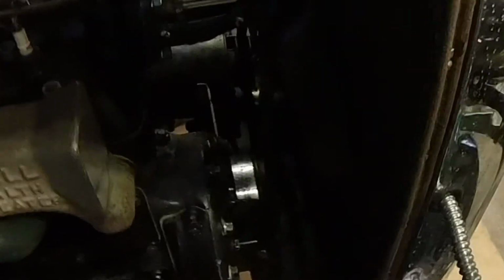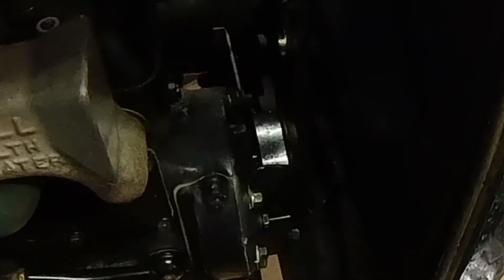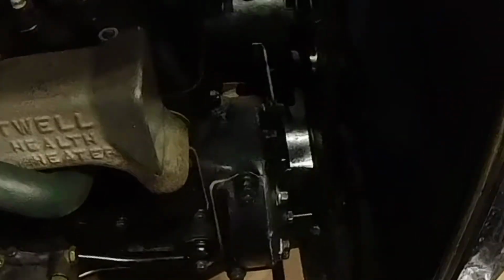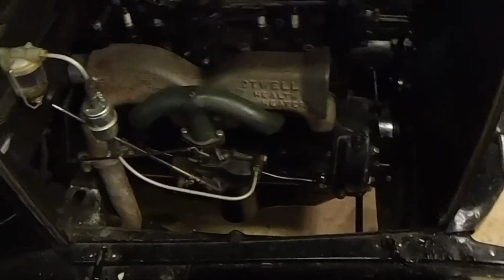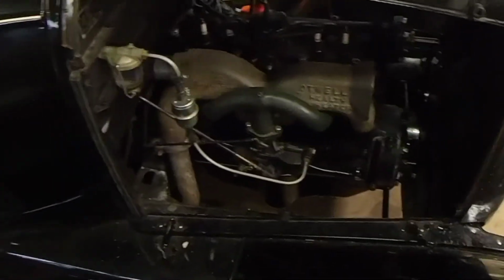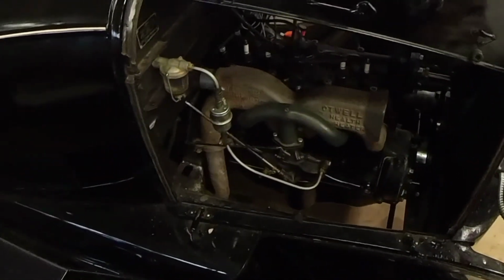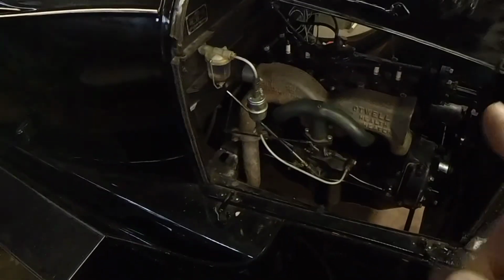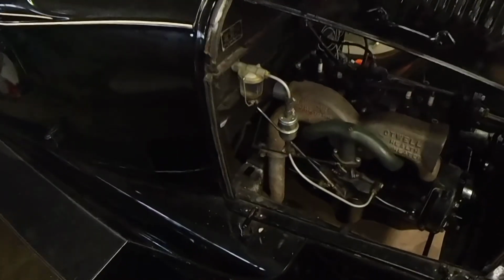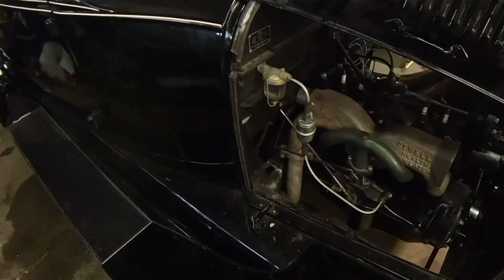And if you look down in the motor, you can see I built a little timing plate that goes in. Is that the shiny plate down on the pulley? That mounts there so I can get exact timing with a timing light. So I know now that when I use the special little cam wrench that they sell for these, and I put it where it should be, the engine is retarded by 10 degrees. No, that's not right. When it's in the full up position, it's 10 degrees retarded. When it's three notches down, it's firing on top dead center.